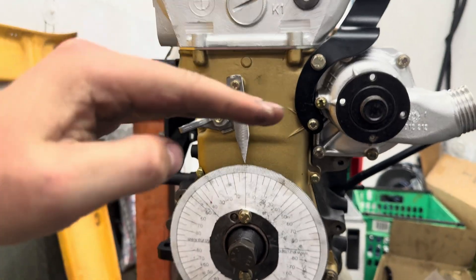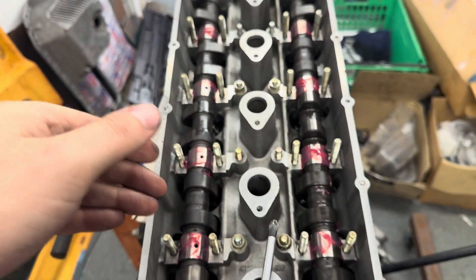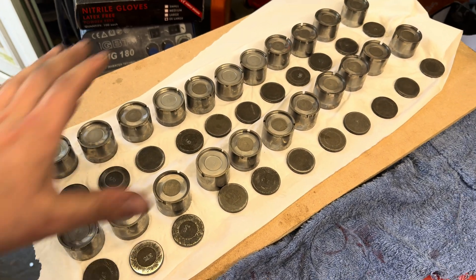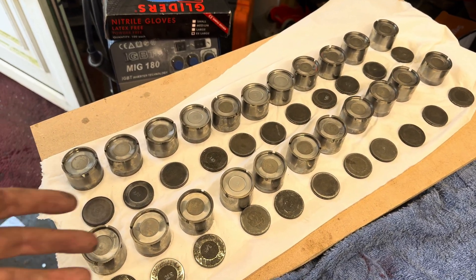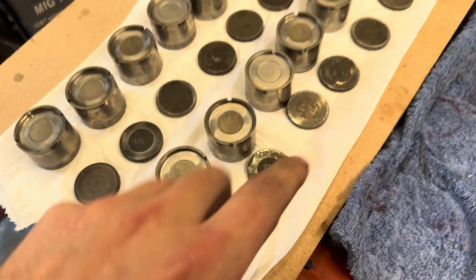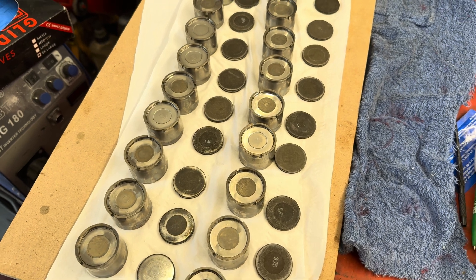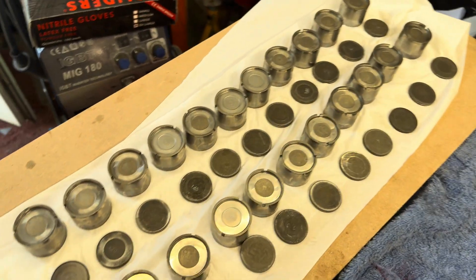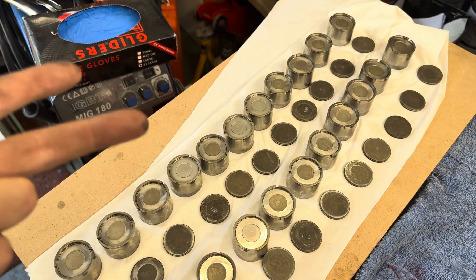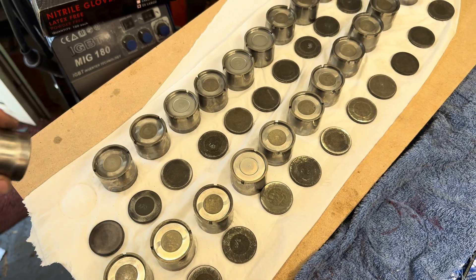I want to clock it back about 45 degrees to make sure there are no pistons at top dead center, because when you're putting the cams in, some lobes may be pushing down. Now I need to fit all the buckets and shims. They used to be aligned in the right order but got knocked about over the years. I've given everything an ultrasonic clean, lost some of the numbers, so I'm going to measure them up and install them as they are. I've checked most of them and they're all within spec.